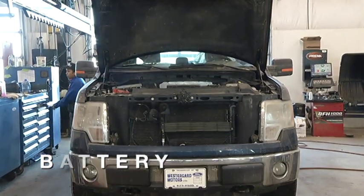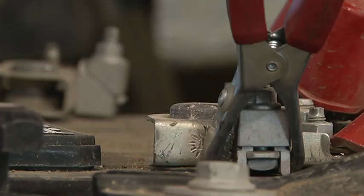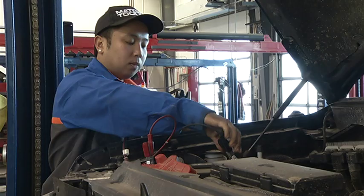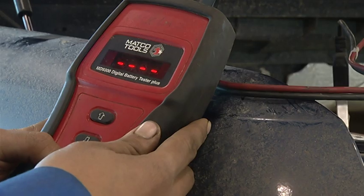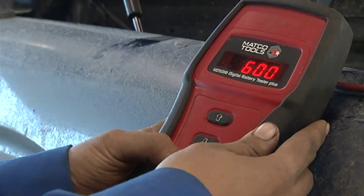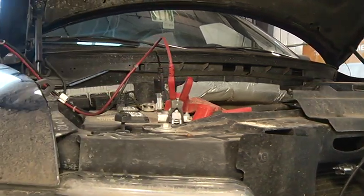If a battery in the summertime is starting to get a little weak, you may not notice it. What happens is when the colder weather comes, and if you do have a battery that's starting to fail — whether you get a cell starting to die — that cold cranking amp availability is increasingly affected by the cold weather. We do a load test on that battery, a cold cranking amp load test. Every battery is rated depending on its size, how many cold cranking amps it has, and we'll do that test and simulate. Then we can tell you whether that battery is weak and needs to be replaced.